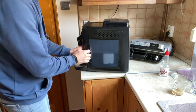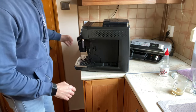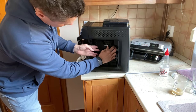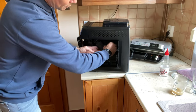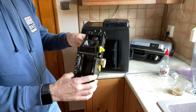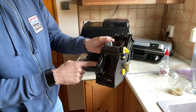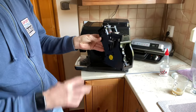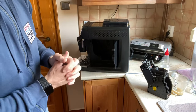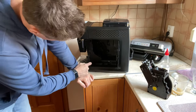Hopefully you are familiar with your coffee machine. Just remove the water tank, open the side door, and here is the coffee brewer. You just push that little bar forward and take the coffee brewer out — it slides out quite simply. You can wash this, and the usual thing you have to do is put the special grease for coffee machines on the yellow spaces. There are plenty of videos about that — it's a proper food-safe grease especially for coffee machines.